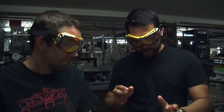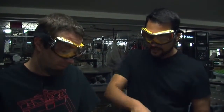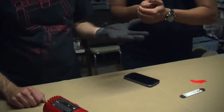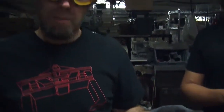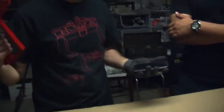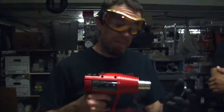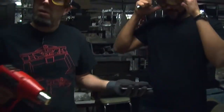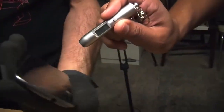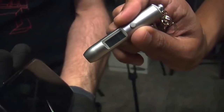Now let's go back into the workshop and find out how to put this phone back together. Burke is holding the phone in a silicone glove to keep his hand from burning, because his heat gun is not variable heat — so he has to vary the heat by holding it farther away. I don't endorse this method; I would put it on a table and vary the heat by moving my arm. Don't try this at home unless you have a glove that can sustain a lot of heat. We've got our goggles on, our thermometer, and the glove — it's time to remove some glass.